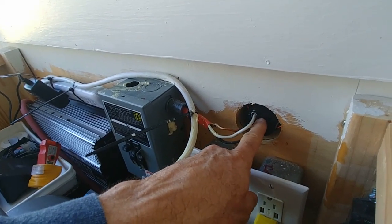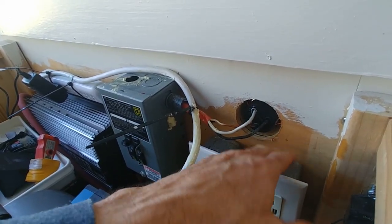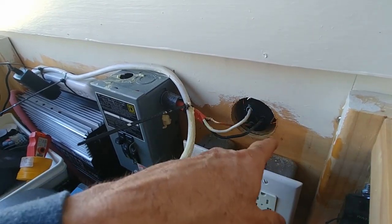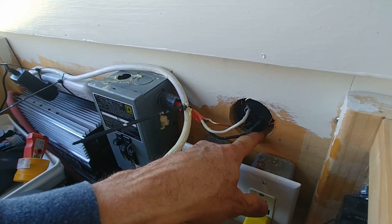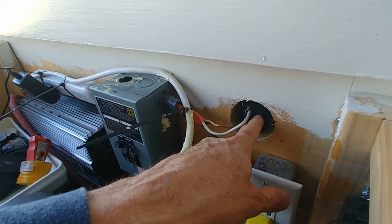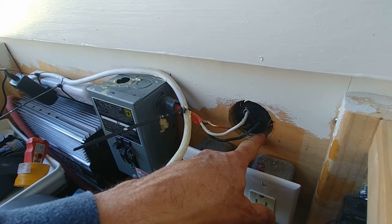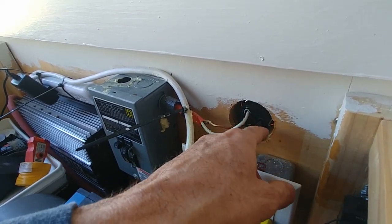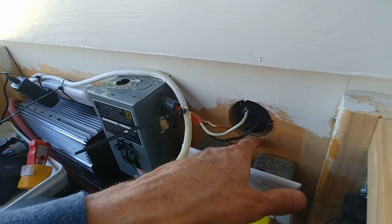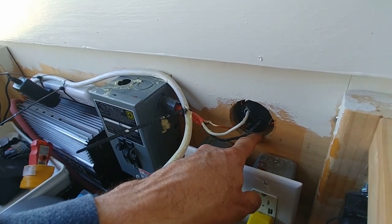Another area I want to improve is safety. This is the backside of the 30 amp power port — it's not plugged in, so nothing is hot. This is three-eighths plywood here. I've got one inch foam board in between the plywood and the aluminum skin on the outside. I'm being told that this insulation is flammable. If this power port were to get hot, short, or have any electrical issue, there's nothing between the heat and the flammable insulation board. So I want to take all of this out, replace those screws, reseat this power port, and put some sort of plastic layer here as an insulator to keep heat away from the insulation.